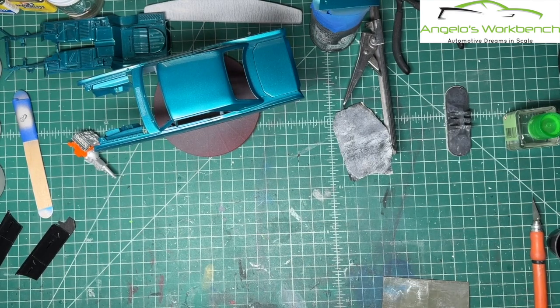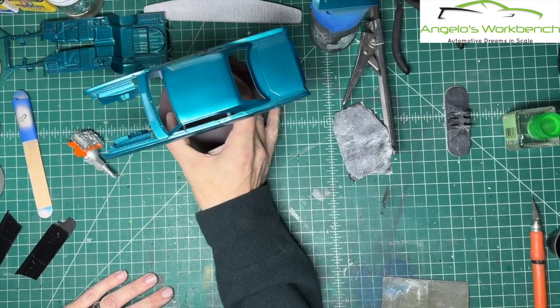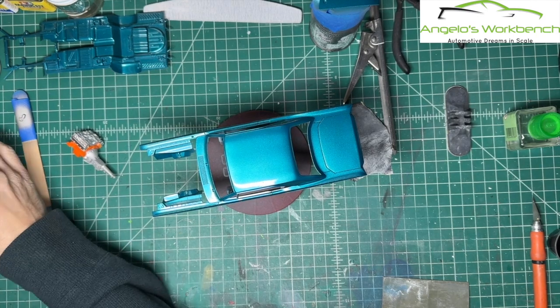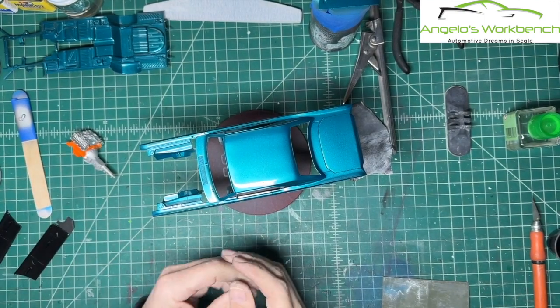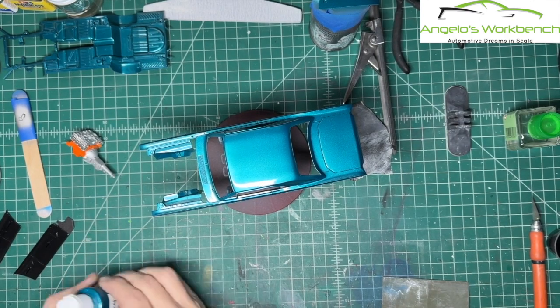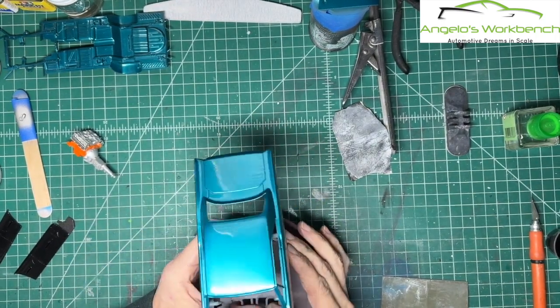Hello, everybody. So to update you on where I am on the 68 Dodge Dart Hemi, I've been doing some stuff. Got some paint work done, obviously. First I used a Wicked Color Silver combined with their UVLS balancing clear, of course, with the 4011 high temperature thinner. And I sprayed Wicked Colors Gray over this. Then I used a pearlized turquoise, to give me kind of like a tealy green that you see here. And now this has one coat of 2K clear.